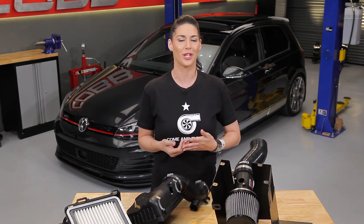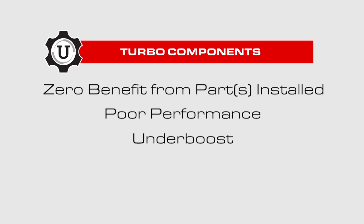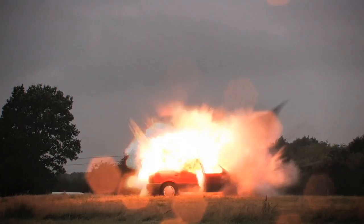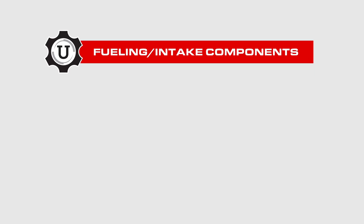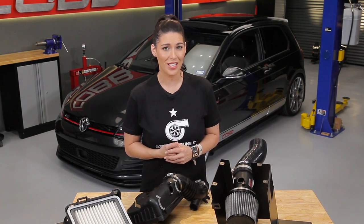So what kind of problems could you run into if you don't flash the appropriate tune? With turbo components, you can get zero benefit from the parts installed, poor performance, and underboost. There's also overboosting — best case scenario your ECU cuts off fuel and your engine is saved. Worst case scenario, you overboost and your engine goes kaput. Fueling and intake components work hand in hand, so you can experience rich or lean air-fuel mixtures, engine running poorly, bad idling, and poor drivability. The good news is that once you have the proper tune flashed to the ECU, you should no longer have a problem and you're good to go.